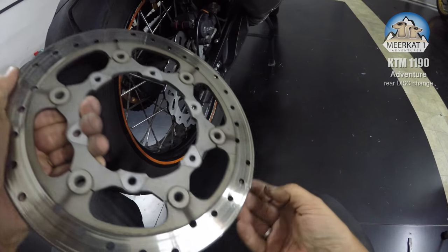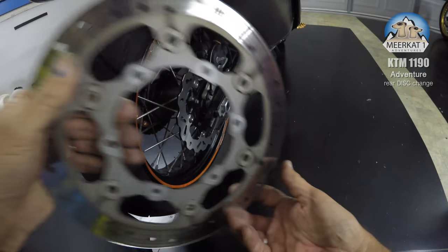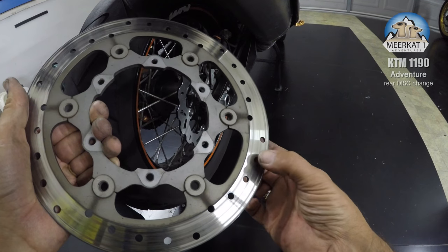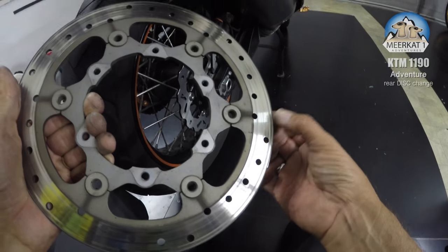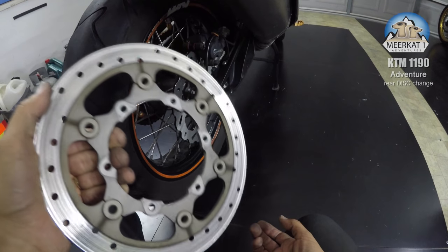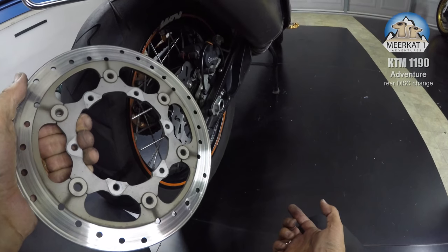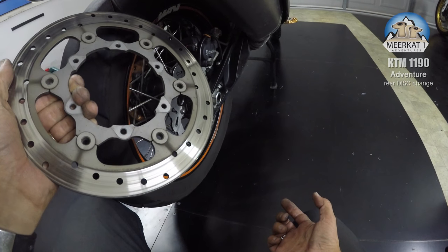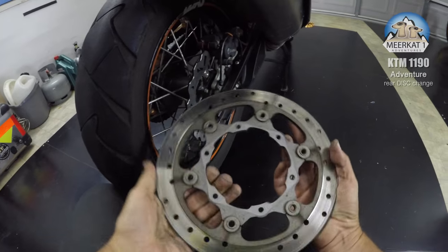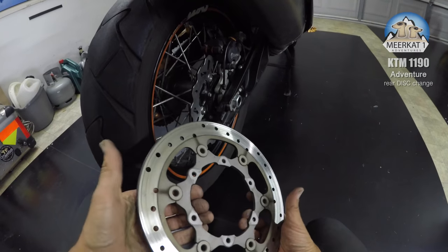I'm noticing a small ridge at the end of the wear area. I had to use the back of the caliper to push through the disc to establish the thickness, because the caliper just wouldn't go over this end ridge that KTM has — the disc is made slightly larger there. The contact area on the KTM is only 23 millimetres radius, and comparing that to the Africa Twin, I noticed it has a 30 millimetre contact area radius. I'm not sure about the wisdom of these particular factory-shipped discs on the rear.